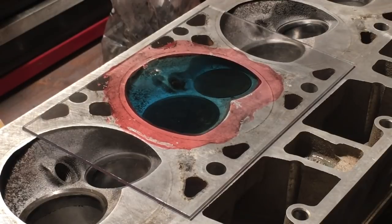I'm totally shocked that I ended up at 217 cc on the intake runner. I was dead on what I normally get on my race exhaust port — because normally when you're looking at an exhaust port on these cathedrals, 81 to 83 cc with the raised roof, that's going to flow 215 cfm or more. So there's going to be no restriction to making power with the exhaust port on these heads on almost any engine. No concerns there. Ended up at 82 cc's on the exhaust port, which was dead middle of what I was shooting for — 81 to 83 — so 82 cc was wonderful.